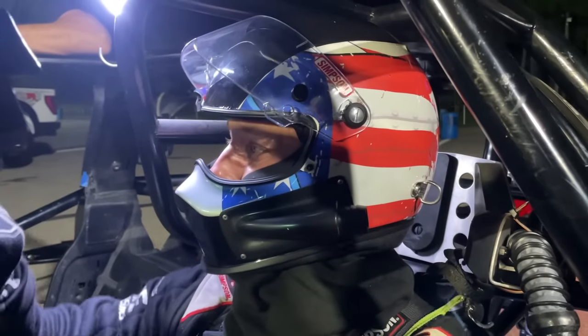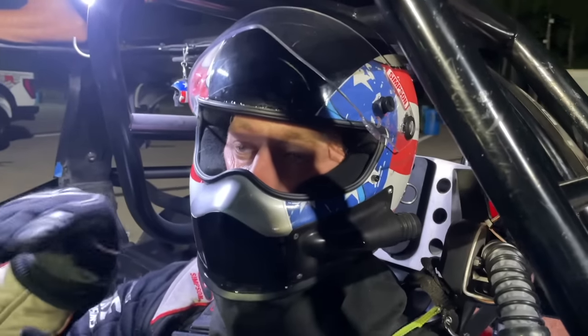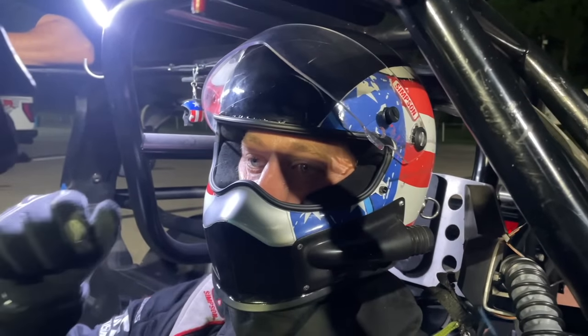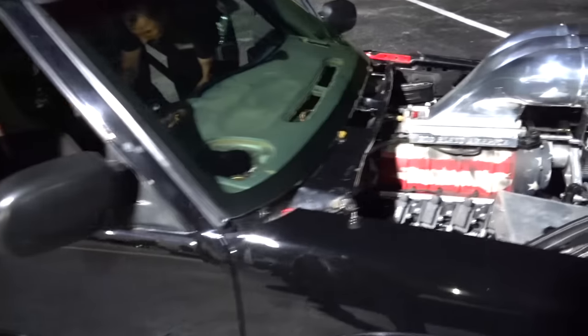Still went 125 to the 60. It needs to hit earlier, so I think we need base turns. There's a big delay between when I lift and it starts really pulling, so let's put a full turn of base in.